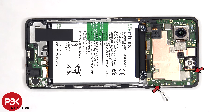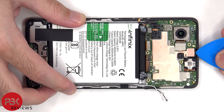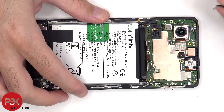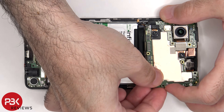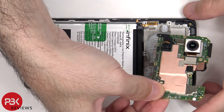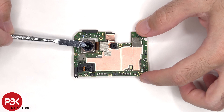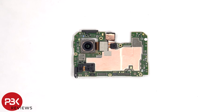At this point there are two Phillips screws which are holding down the main board. Looking at the main board, there's a 108MP primary camera and a 2MP depth and macro lens. None of the cameras have OIS or optical image stabilization. The camera connectors can be disconnected by just popping them off. There's a secondary microphone located up here, a liquid damage indicator sticker, and some copper tape on the shields to help transfer heat.